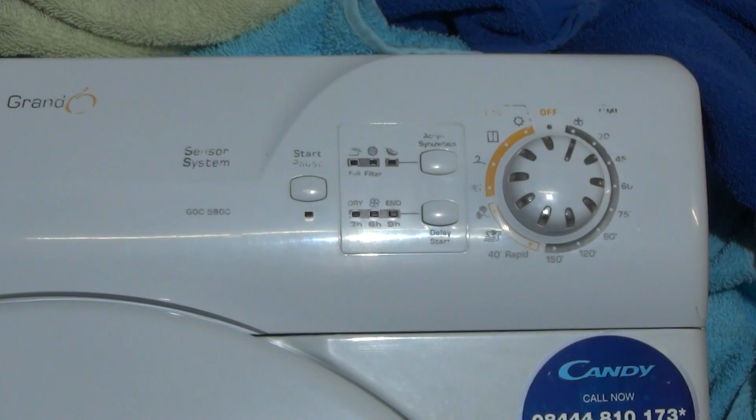The cool down, or freshen up as it might also be known, is to be used if you interrupt one of the cycles while the machine is still completely hot. Put it on this cycle with nothing in, and it will cool the actual heater down to prevent it prematurely blowing. Unfortunately, a lot of people ignore this and their heaters prematurely blow. So unfortunately, that's what happens.